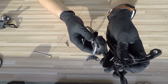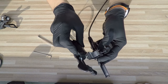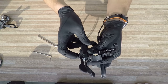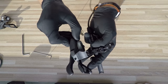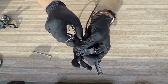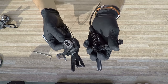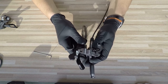We have this little pin here that goes into this hole, which means we are unable to adjust the angle of the shifter because it has to sit in a fixed position. On i-Spec 4, they should remove this pin and make the hole longer so we can position the shifter freely, and perhaps add small grooves so it fastens securely — just as has been done for years on seatposts for adjusting saddle tilt. It would be extremely easy to do.